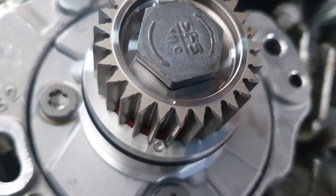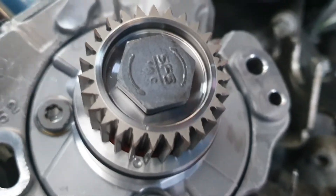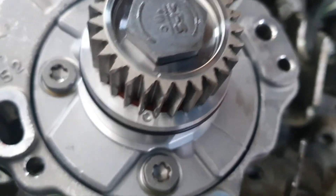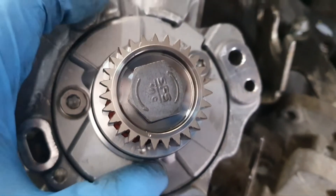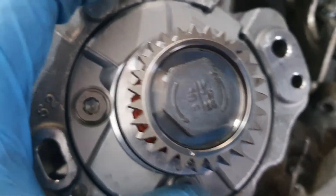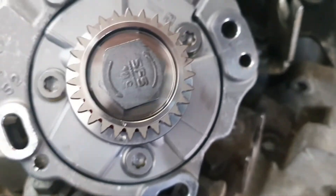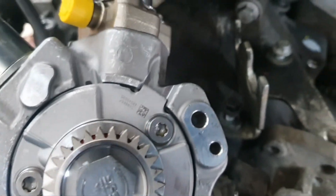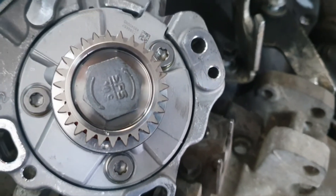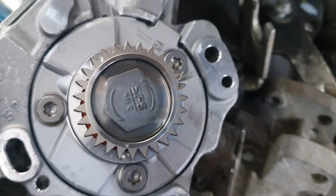If you do not time these engines they tend to run pretty well, however we have found quite a lot coming back, and when they come back the teeth on the timing belt are actually stripped. It turns out it's because people aren't actually timing these fuel pumps. We've had some that have done a couple of thousand miles, some have done 30–40,000 miles — it really is all down to potluck. We'll get that fitted, we know it's all freshly in time. I hope this video has been of use to you — please don't forget to hit the like button, subscribe, and leave a comment. Thanks for watching.